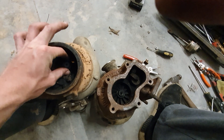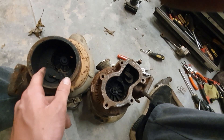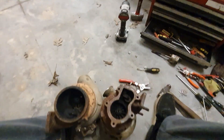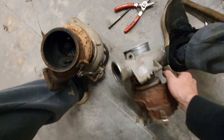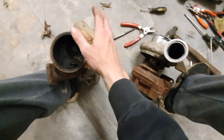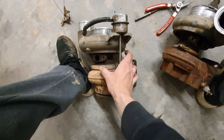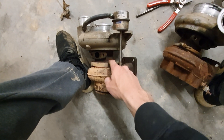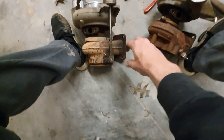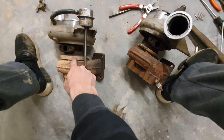You'd want to mill this out to accept a 67 or 76-67 turbine. Brad at Savage Fab builds a turbo he calls the HX Super 9 — it's an HX35 with the HE housing mounted onto it via welded tabs with threads using the screw holes, because an HX35 doesn't have a V-band — it has four screws connecting the bearing housing to the exhaust housing. The HE has the V-band, which is a big advantage.